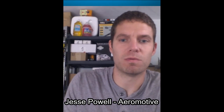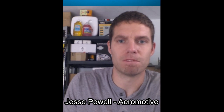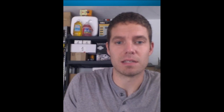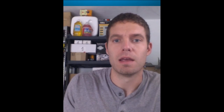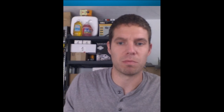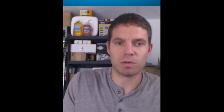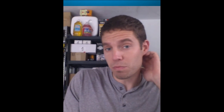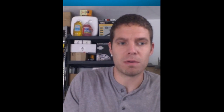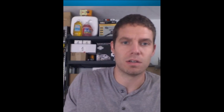This is a pretty similar system. Actually, it's almost identical to what you would find in the COPO Camaros or the Cobra Jet Mustangs. It's a really basic system. I mean, there's nothing really that special about it. What we've done is simplify it. Rather than having a fuel cell and then making sure it's sumped properly, an external pump, and the filters and all that plumbing, we've taken it all and packaged it inside the cell. So you can put the cell anywhere you need to in the car, and then just run a simple post-pump filter or regulator and a return line, and you're good to go.